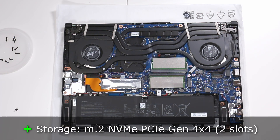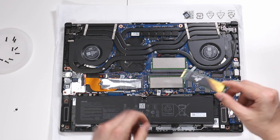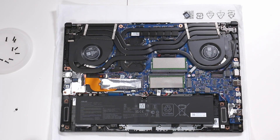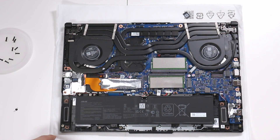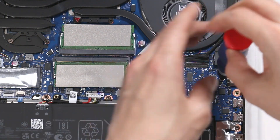What I'm going to do now is insert a second SSD into that slot. Before you touch anything though — I just made a very big mistake. Putting this laptop on top of this material was not a good move; this stuff carries static electricity. Discharge any static electricity before you touch anything or you might end up frying a chip. You can discharge by touching anything connected to ground.